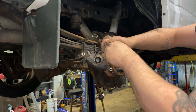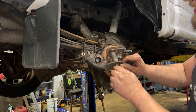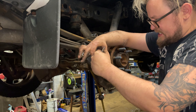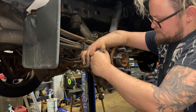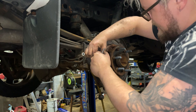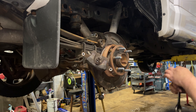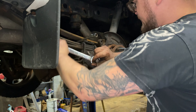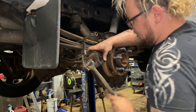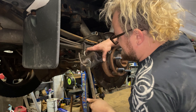The piston is fully extended so we've got to bring it in a lot. We've got a little plate on the tool — if you're using the cheap one, use your old brake pad if it doesn't come with a plate. Get it in there right around the caliper piston. When you're compressing these it's always a good idea to open your bleeder valve. We're going to do a brake bleeding after we're done — always recommended. Just turn this and as we're turning it, it is pressing the caliper piston in. We're putting new pads and rotors on so it needs to be all the way sunk in.